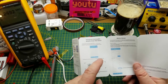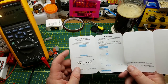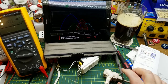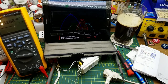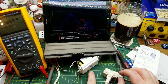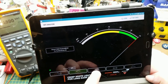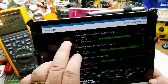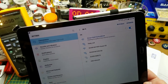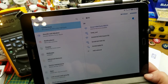To pair it you need an Apple app, which I don't have and I'm not going to get — I don't have any Apple phones, that's a conscious choice. As a Wi-Fi device I'm probably not going to be able to use it. Let's see if it shows up as a Wi-Fi device. Presumably it sets its own access point. Push the switch for three seconds — now we've got our blinking pairing light. Look at that — a smart wall switch is putting out a signal. I wonder if I can connect to it. Connecting... connected to Wi-Fi network 'smart wall switch'.